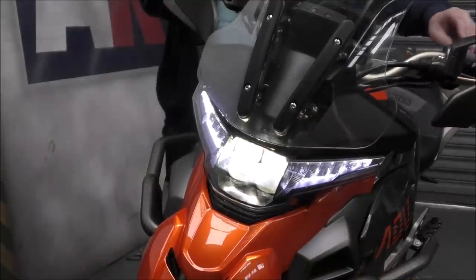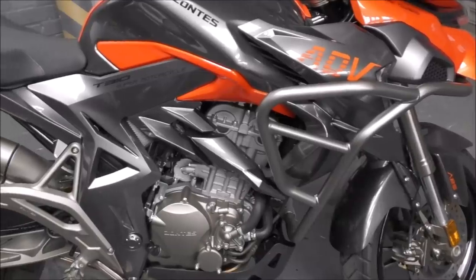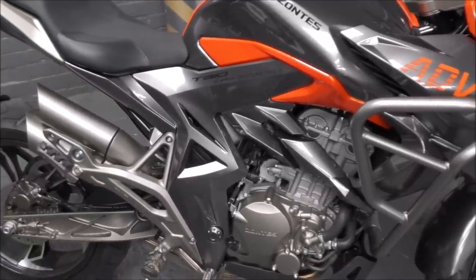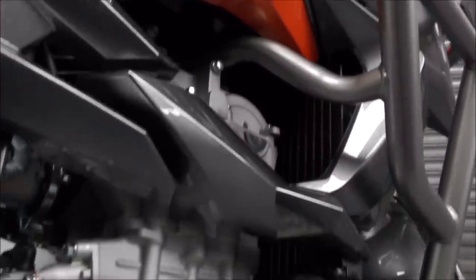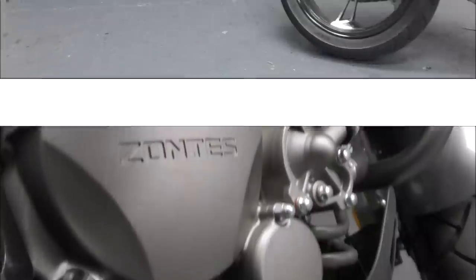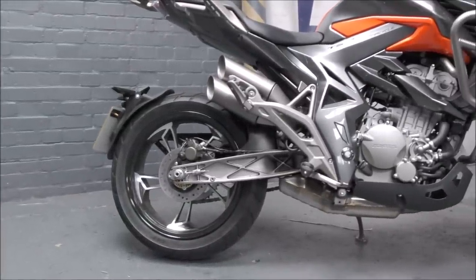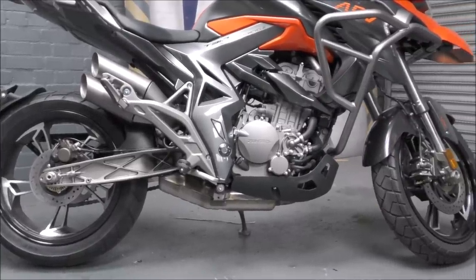The 310 is powered by a 312cc single-cylinder engine with four valves and double overhead cams. It uses an aluminium and nickel carbide plated cylinder, which helps dissipate the heat more efficiently. That, in turn, makes the bike perform better. It is water-cooled and uses a Delphi EFI system. Friction and vibration is reduced by using a mid-mount balance shaft, and it uses a dry sump with external oil frame reservoir. So what? I hear you state.